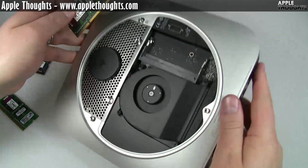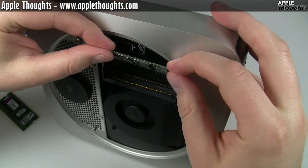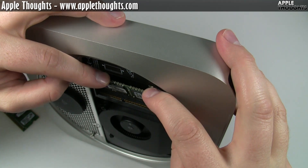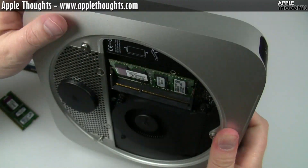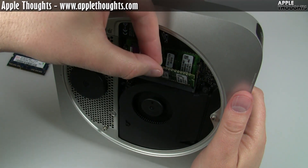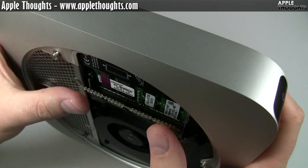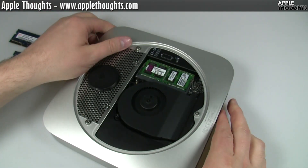Okay, we're back. I used my little pocket knife to pry out the piece of RAM — of course, you want to be really careful with that. You want to go in at a bit of an angle, but you don't want to let it drop back, so have it leaning forward a little bit. Then press down until you feel it connect and you don't see any pins. Then push back and it's in. With the second one, it's a similar deal — come in at an angle, push down until you feel it connect, then push it back until it clicks.